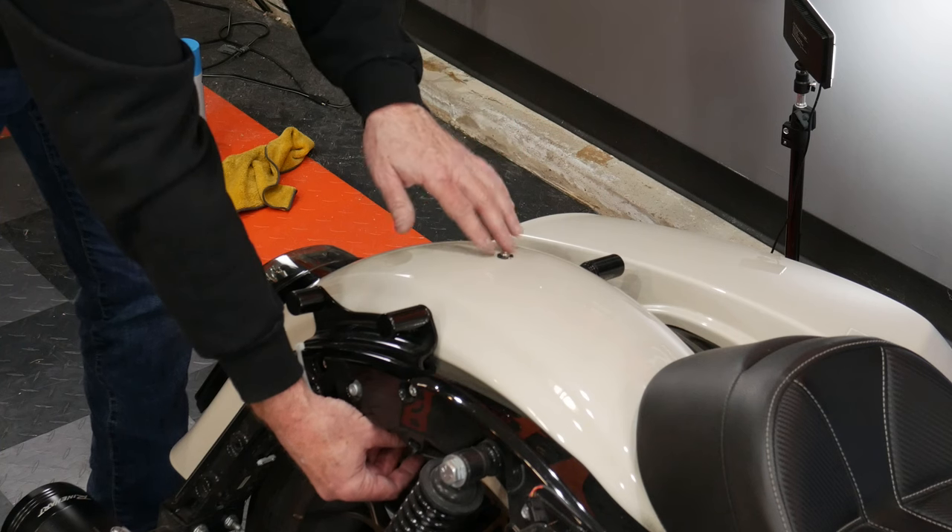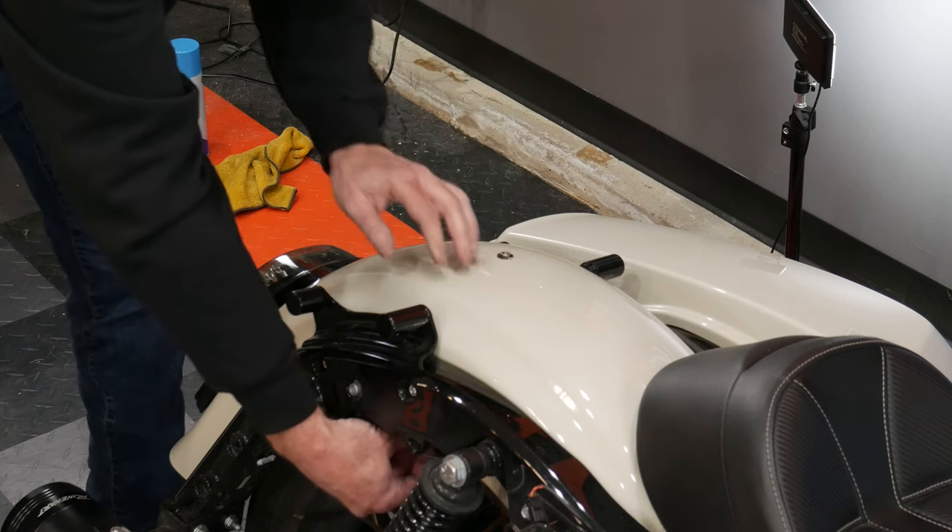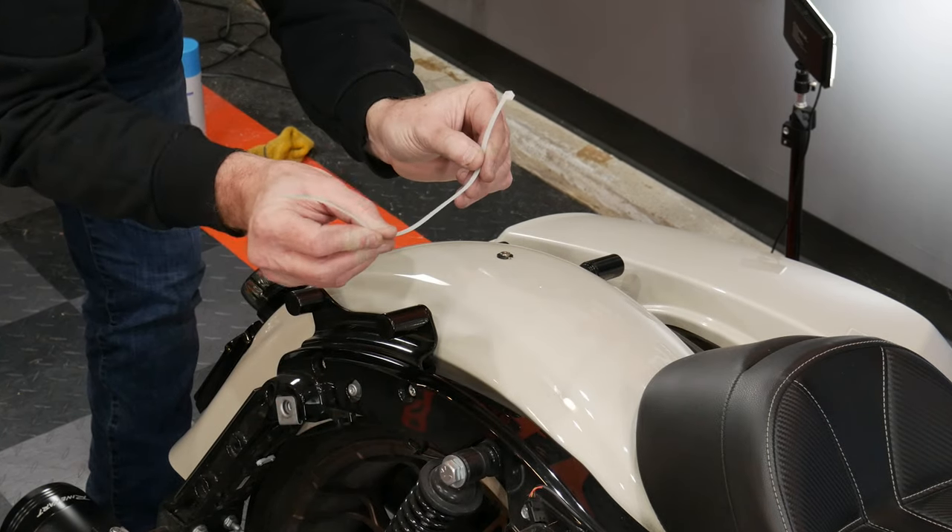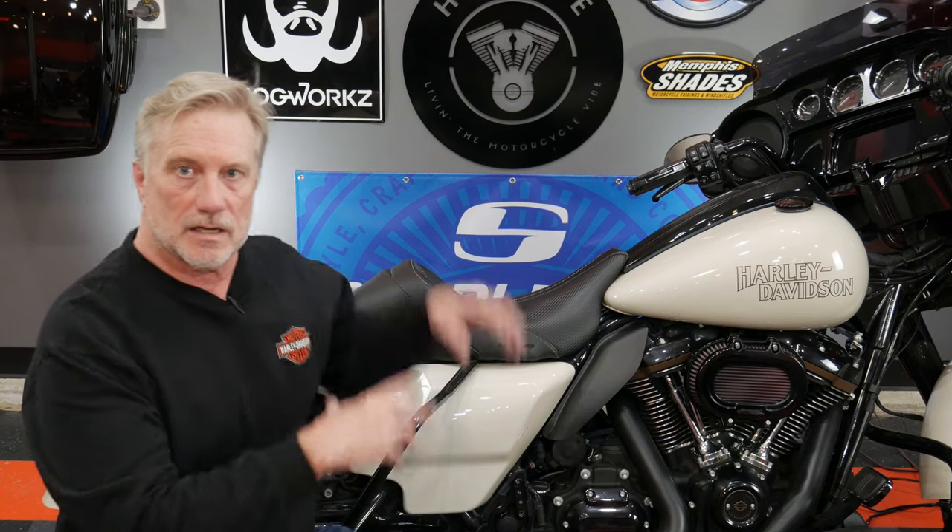After just a little bit of fishing it around, I actually got the zip tie to come through. Then you just turn that seat nut into the right position — it has a little oblong space in it. Just make sure you get it lined up correctly. Once aligned, it slips right in, and then you just take your C-clamp and slide it in from the back and make sure it's secure so you don't drop that nut. Now that nut is in my fender and ready for a two-up seat.